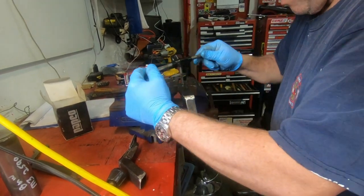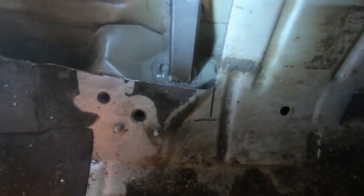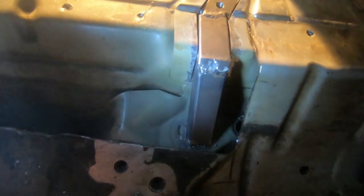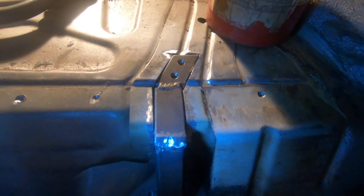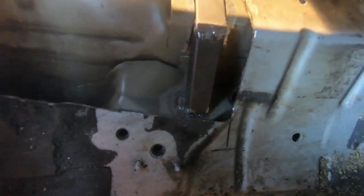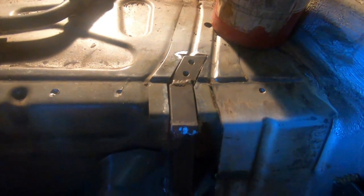Tapping in the threads for the removable subframe brace. Here's where the magic is — you can see this custom bracket that was built, sitting on top of the carrier bolt for the front subframe. With the panel removed, it follows up, sits on top of the panel underneath, then jets out into the floor in the rear where you can see two bolt holes where the removable brace will go. Welding this in place is going to be enough to support the subframe, and the removable brace gives it that much more strength.